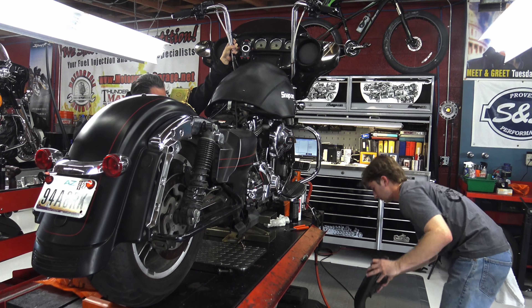I want to show you the difference when you go to install this. The left side is the primary side and if you look at the dial indicator, it's about three-quarters of an inch in depth. If you flip to the other side you're going to see there's more depth — almost an inch and a half total. So what we're going to do is dismount the tire, install the ABS bearing correctly first, and then install the right-side bearing so the wheel will be centered correctly with the correct spacing and the ABS sensor on the correct primary side.